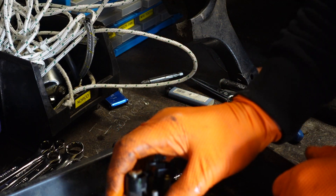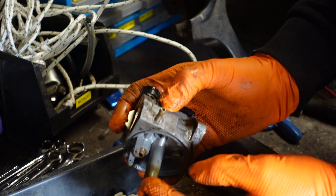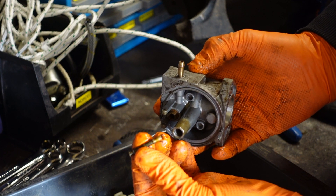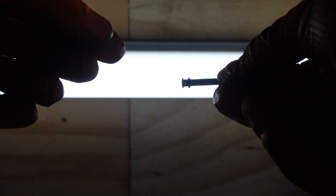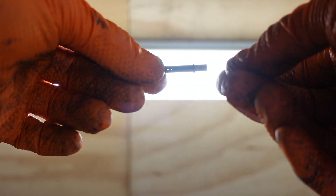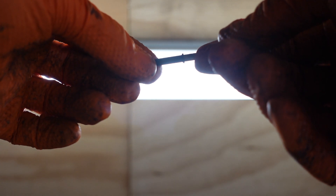Your other jet should tap out. There you go. As you can see how that's come out — your narrow piece goes in first. I'll hold this to the light. You can see we have a small amount of light coming through those holes, whereas on this end there is absolutely none whatsoever, because those holes are clogged up.